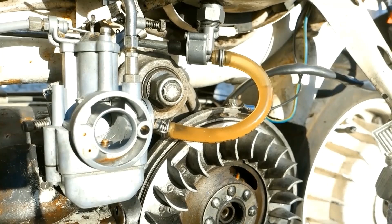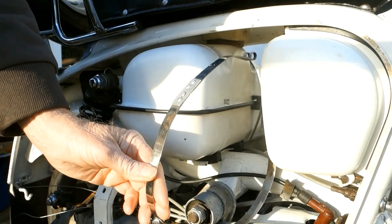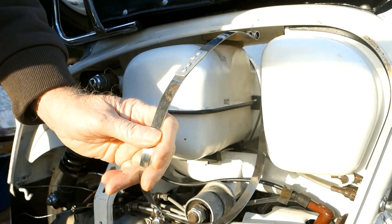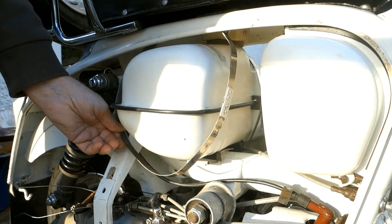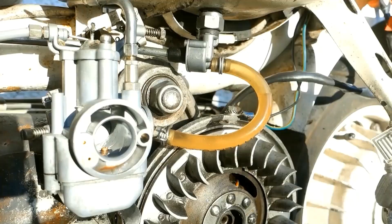This is PJ, the other scooter, with a horizontal outlet. Looks better, looks easier, looks like it simplifies things — might be a good option. I'm working left-hand at the moment, but this is a tank strap — had to snip it in half to get it off. I've done a homemade repair: strip of aluminium, four pop rivets. Could possibly have bonded it somehow, but I'm okay with it. So I shall put it back on and leave it as is — it's a little feature. And then sometime in the future, perhaps if there's a crowd about and I remove the side panel, it may turn out to be absolutely riveting.